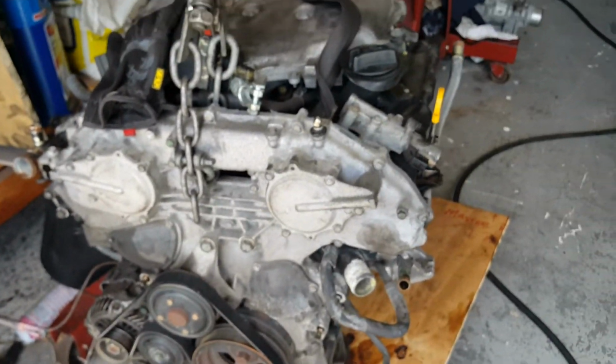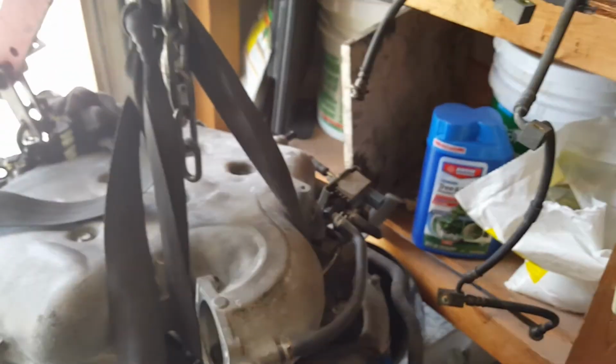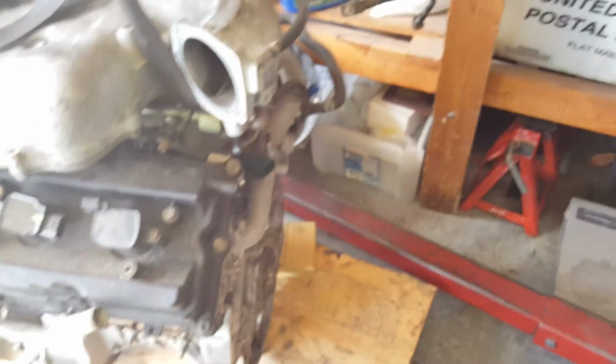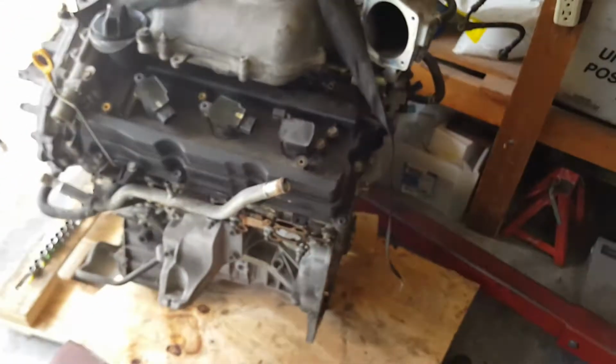So my belts, like I said, are resolved. Now to look at these coolant lines, and then the emissions and my vacuum lines, because I want to make sure I don't have any boosted air going into my valve cover. Then I'm going to take out these PCV and see if I can find an AN fitting or some type of fitting, so I can run those to atmosphere to a catch can, like we all do. But besides that, yeah man, it's coming along.